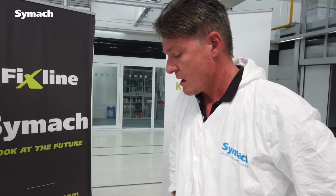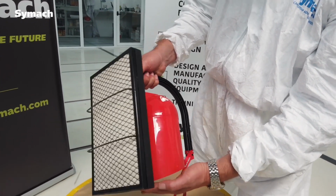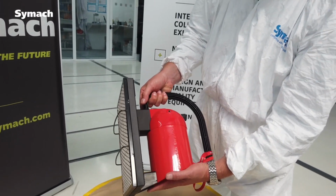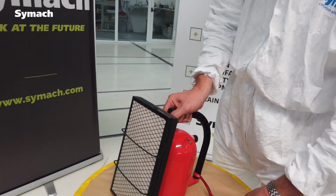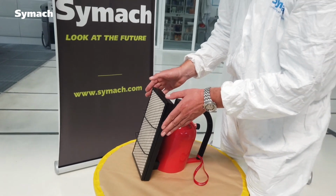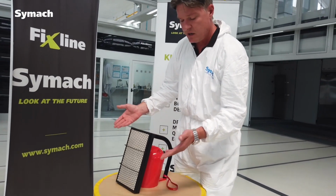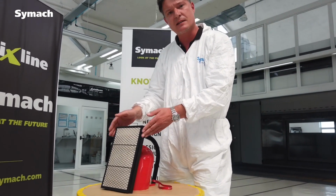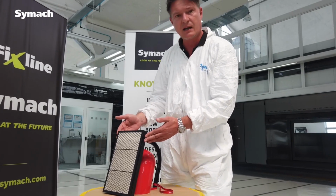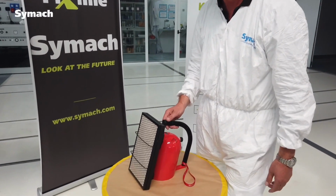Exactly. What other features are there on this unit that you can tell us about that we need to know? The DryTron is very, very comfortable stuff. With that lamp, we can dry every product from the filler, primer, base coat, and clear coat in a few seconds. You remember that, Wayne? As you did yesterday, we can dry the filler in less than 1 minute, ready to sand. Yeah, it works really quickly.